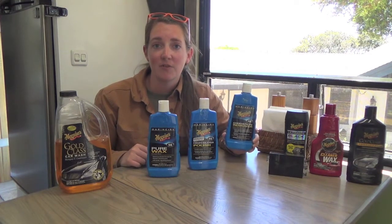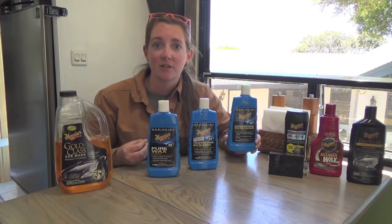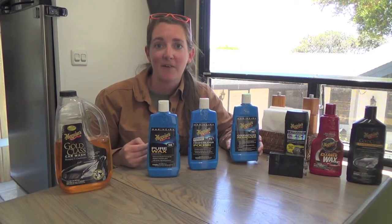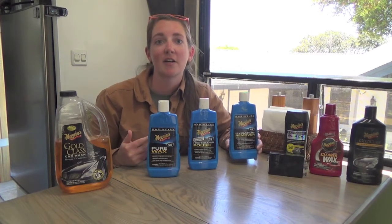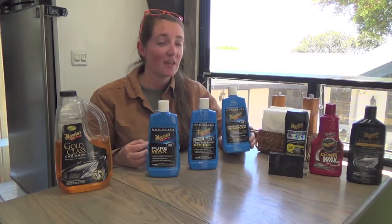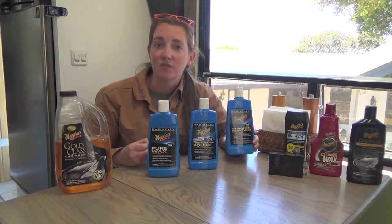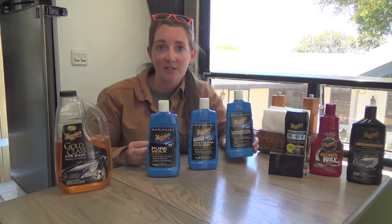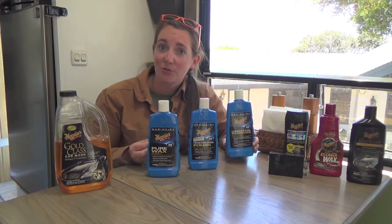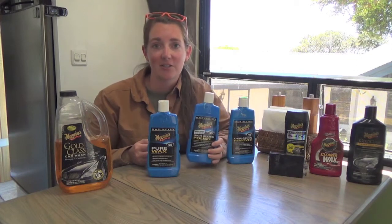The oxidation remover is used to enhance the color and help with surface degradation. It's helping to restore the gel coat and fiberglass to a glossier, more bright white color. This is abrasive enough that it does a really great job of that, however gentle enough that we will not destroy the fiberglass. It's followed by the polish.